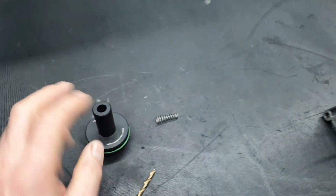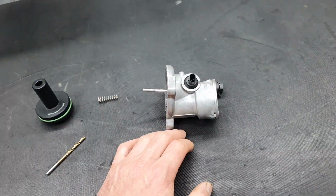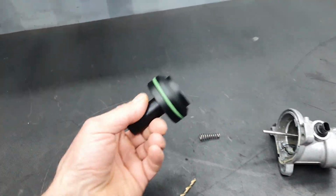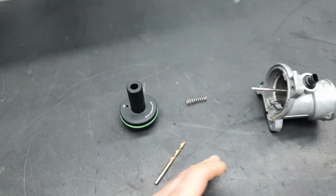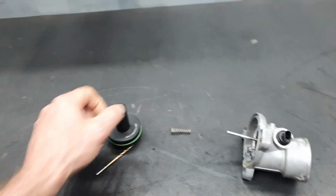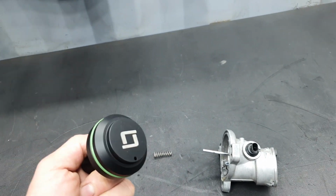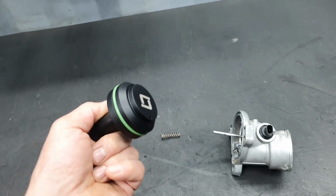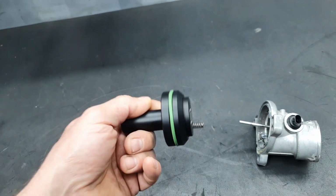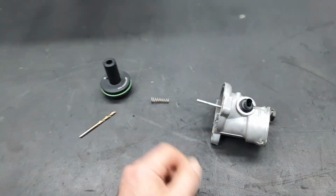That's the first thing. Second thing, you're going to have a stored fault on the ECU if you run a diagnostic, let us say, after a month of using the bypass, and it will say that the coolant temperature cannot reach operation temperature, because it will never reach it. It will reach it only under a hard pull. On a hot day, it might reach the operation temperature, but it will never reach 110 degrees, where the coolant is supposed to be with the original thermostat, 105 to 110 degrees.